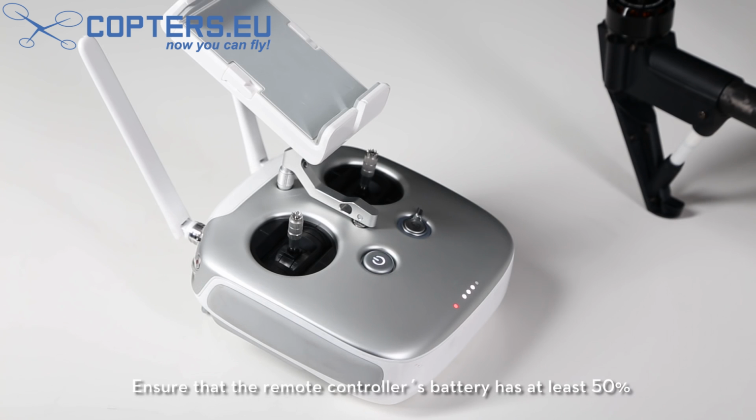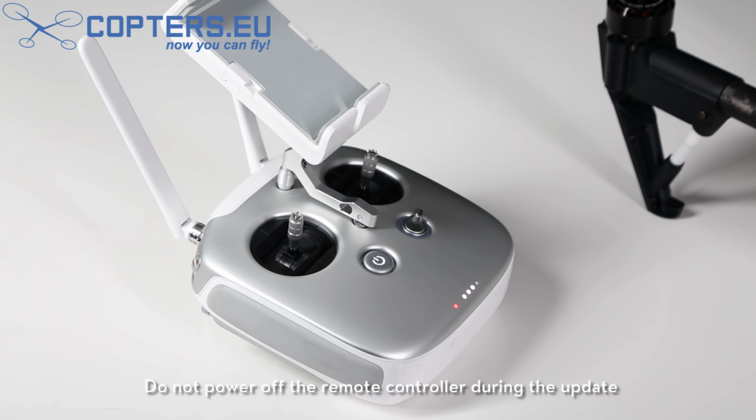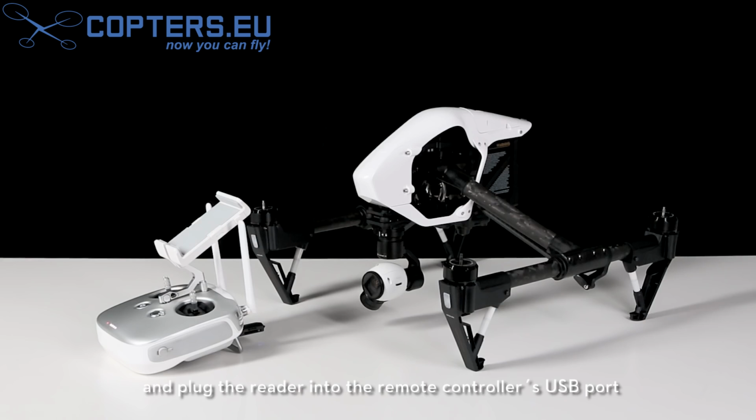Updating the remote controller. Ensure that the remote controller's battery has at least 50%. Do not power off the remote controller during the update. The remote controller's firmware is included in the update package downloaded from the official DJI website, DJI.com. Insert the micro SD card into a card reader and plug the reader into the remote controller's USB port.